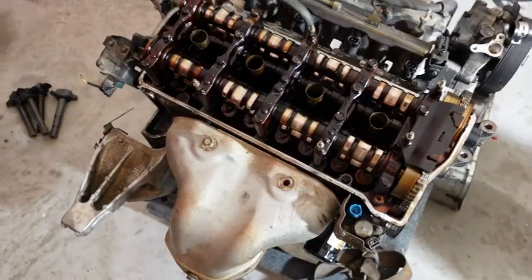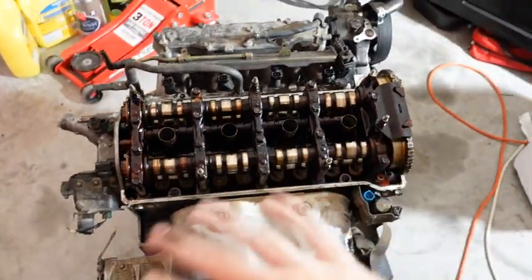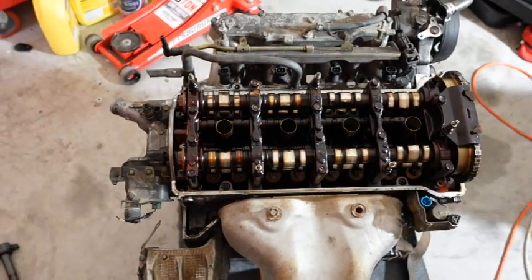We really need to pull the head off and look at how bad everything is in here. I want to make sure before we proceed that this motor would still be okay even if we cleaned it up and rebuilt it. The issue with sludge buildup is that people aren't taking care of the motor and are not getting the oil contaminants out. The oil starts to solidify and clog up, and then it settles — it's no longer moving through the engine. So you have less lubrication, less cooling capacity, and less oil. Oil sludge — if you see it, it is not good.